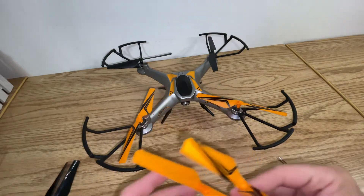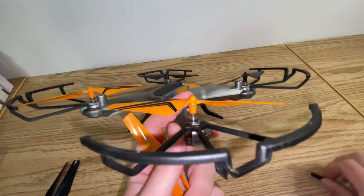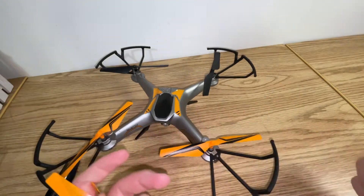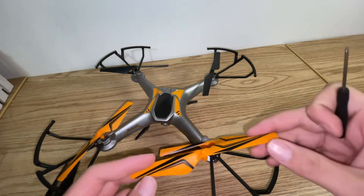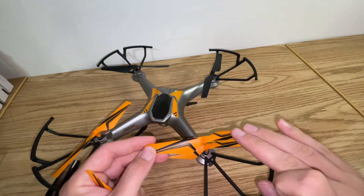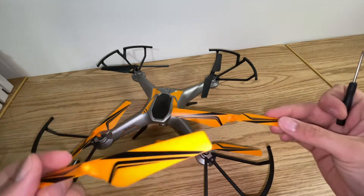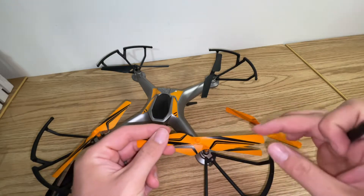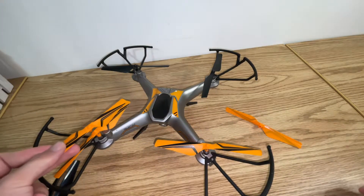We're going to show you with the orange ones here. All you have to do is look for the small screw, which is right here. The screw hole on the new replacement blade is right there, so you line them in the same direction. This is the one you want because the curve of the blade goes like that, which matches the curve of this blade. If you take this one and face the screw hole towards you, just like the screw hole is here, it's actually facing in the wrong direction for the curve — that one is for this blade here.